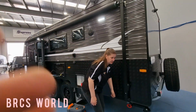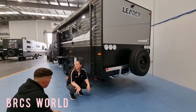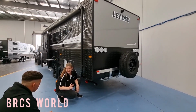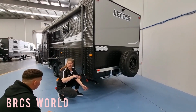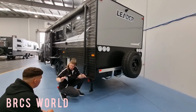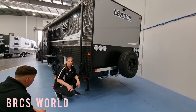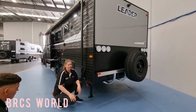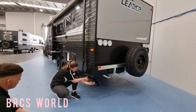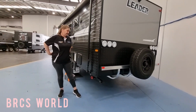And down here you have your stabilizer legs. So these are to stabilize the van, they're not to level the van. Usually caravan sites are pretty level, so you should be alright. All you'll do is make sure it's level and you're ready to go. You're not staying in the van with everything rocking to one side. And to stop that swaying motion, because you'll notice it when you jump in, that's what they stabilize, so it sits on firmer ground. Don't try to lift the van. Not lift it up, isn't it? Yeah, they're just to stabilize. You can actually buy levelers if you want, so when you drive onto them, your van's not sitting that way or this way.